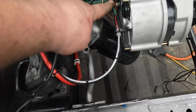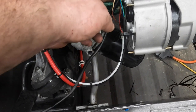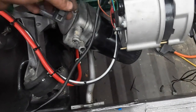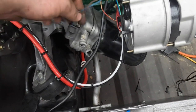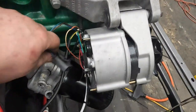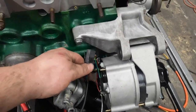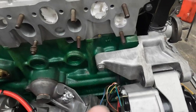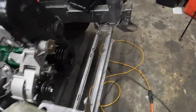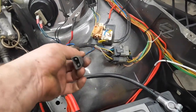There's the blue and green starter wire. This yellow and black — I don't know yet, we'll see if that stays or goes. The blue and brown is for the battery overheat sensor at the battery. This is an earlier style alternator so we don't have that — it just tells your indicator light on the dash to come on when the battery's melting. And of course the other end of that can go away because it's not going to do anything anymore.